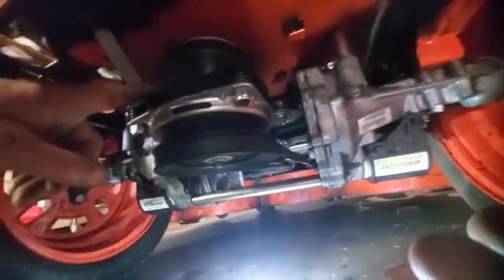First, we'll go ahead and get the clutch off. This is usually 5/8. And then what's holding this on? Yeah, we got the PTO wires, of course, that go to the clutch. Find out where the plug is. So the plug is up here on the engine deck someplace. I haven't really located it yet.